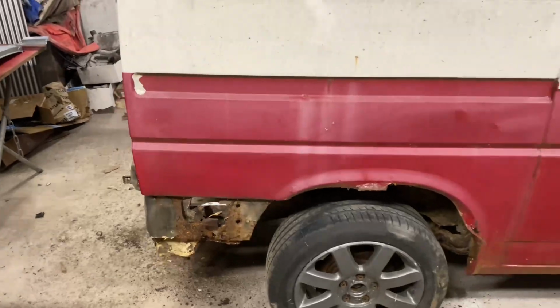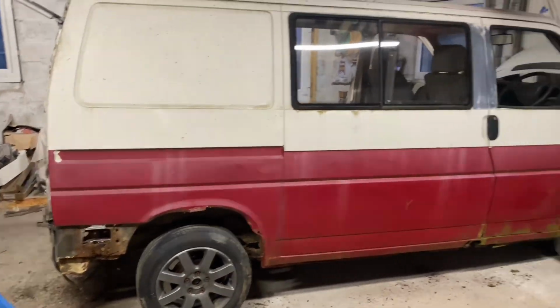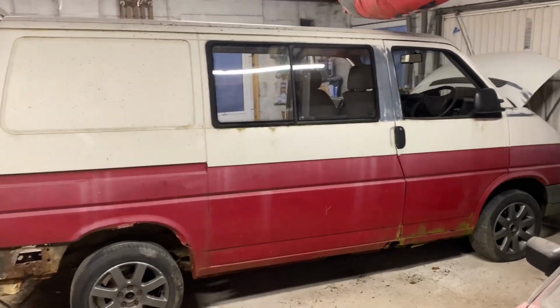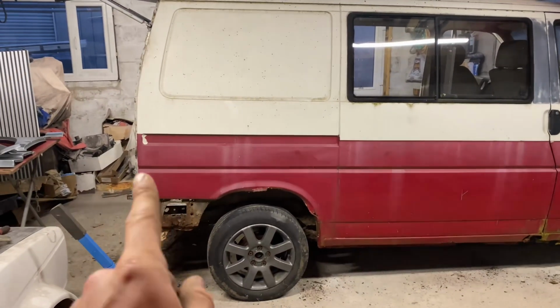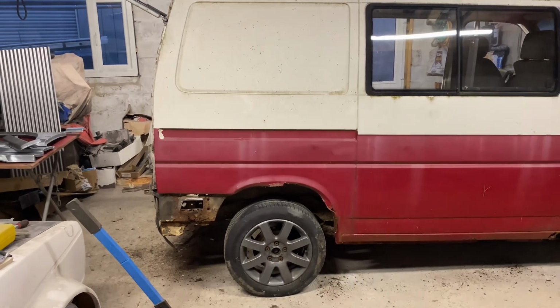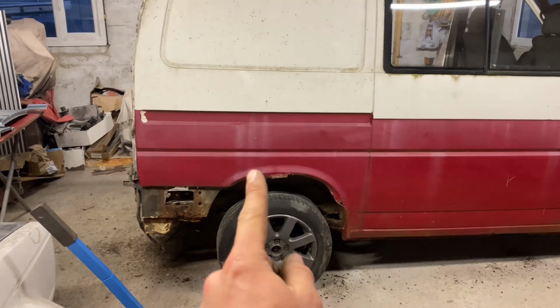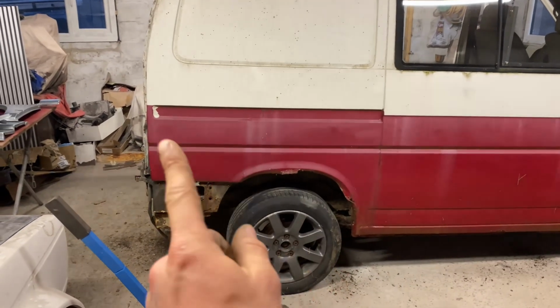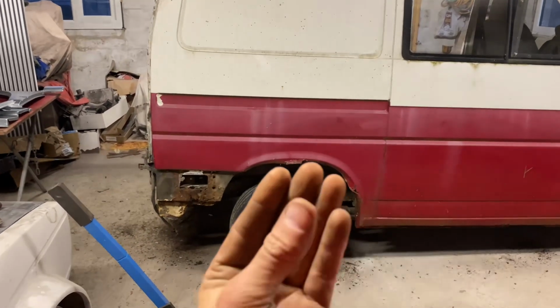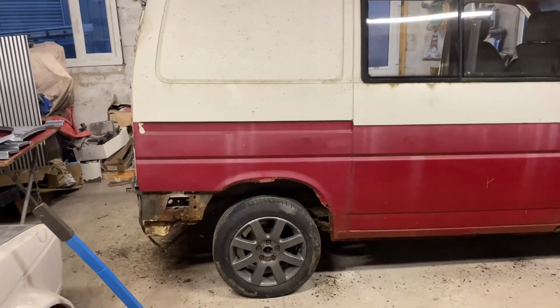So I'm going to end the video here, and I hope to see you in the next one where we'll start getting stuck into this van. We'll maybe see, probably going to start with these quarters, see if I can get them fixed up. I suspect the inner arch here might just need a bit of a patch as well once we've cut that quarter out, just so that there's something for the two panels to spot weld together with.